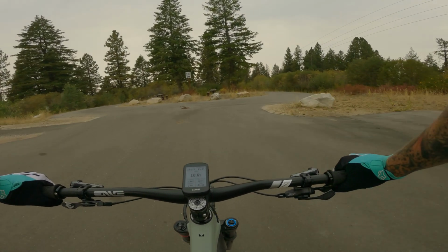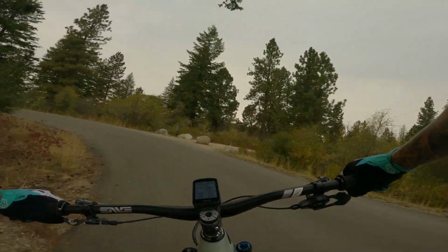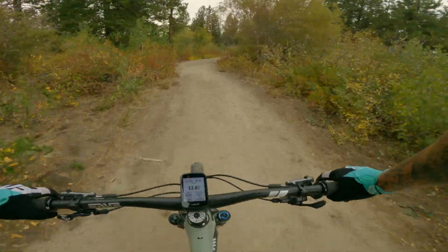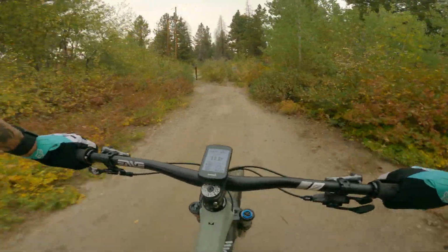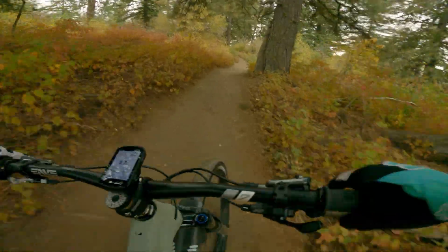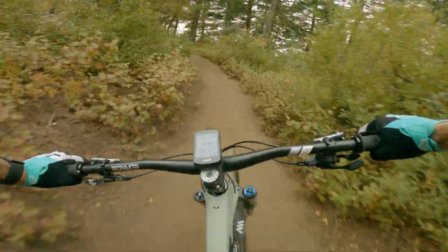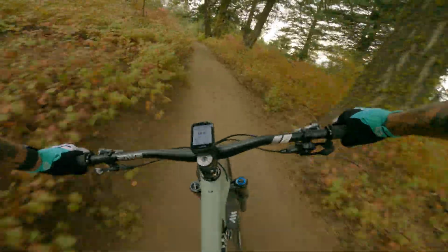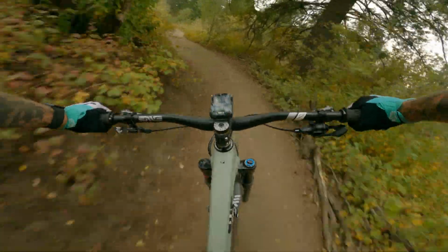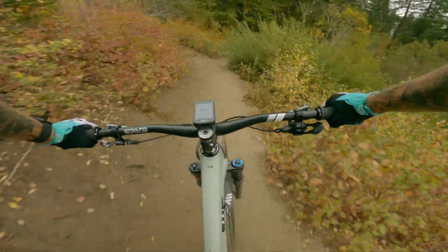Whew. It's a lovely, smoky, overcast day on the Maxxis High Roller 2. 24 PSI up front and 27 in the back, Aggressor 2.3, High Roller 2.5, and see how we like her. It's kind of like a tire that no one really talks about. It's always Minions and Assegais, and recently the Dissector. Also running the 203 front rotor up front.